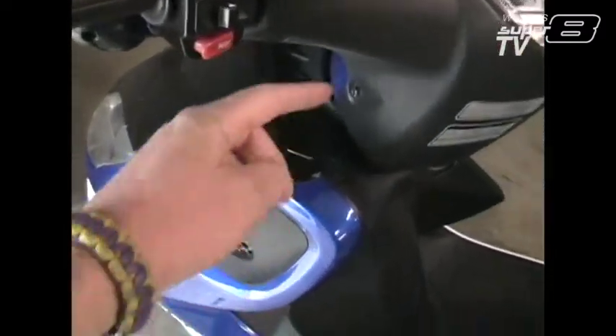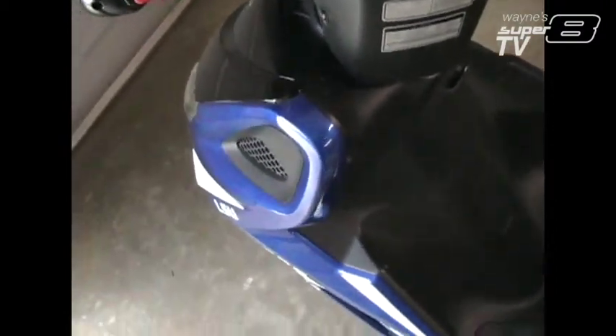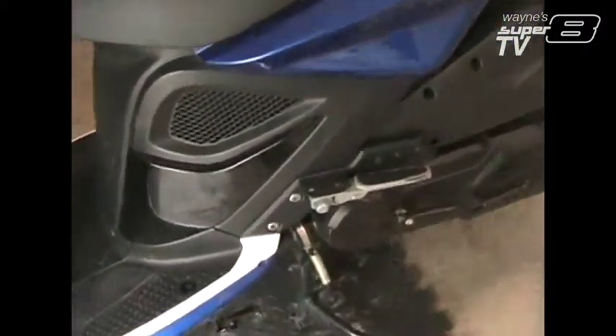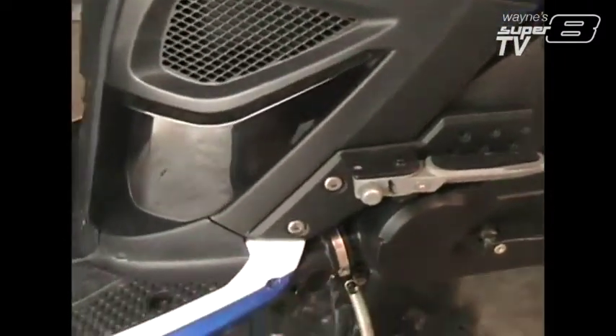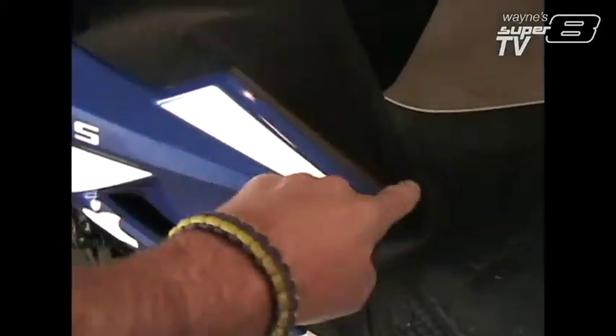It's going to be a little tricky with the wiring because some of it's going to have to come down through here and then go down to the battery in the bottom there. But before I do that, I've got to take off a bunch of different panels — I'm going to create a separate video for taking off the panels, so check for that on my channel. In order to get access to this and get this whole front cowl off, you've got to start back here at the foot pegs — the foot pegs have got to come off.